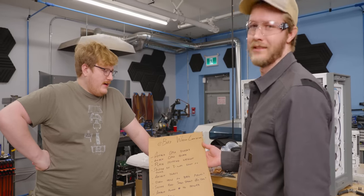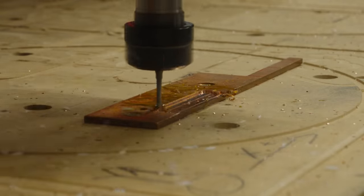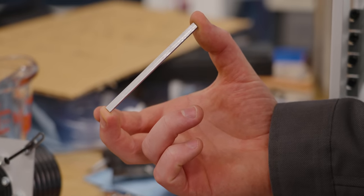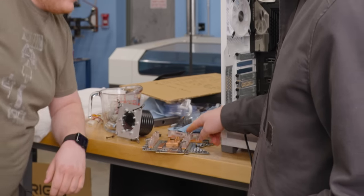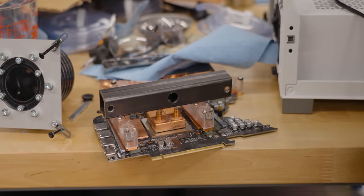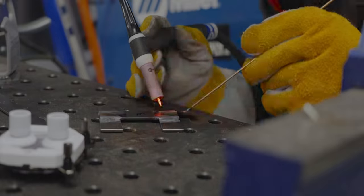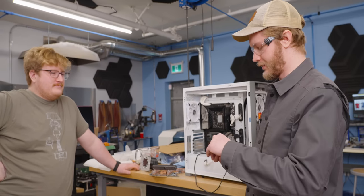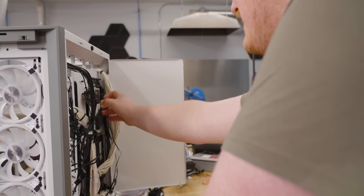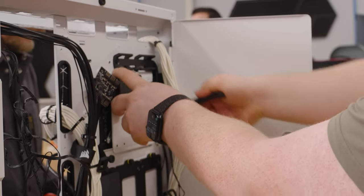We have a lot to do. I've been mostly just turning garbage into bits of water cooling. In order to attach these I machined out some copper for the memory, aluminum for the MOSFETs — those are just to space it up. I consulted multiple engineers — three of them. Do you want to know what they decided for attaching these? Zip ties and a piece of steel. For the CPU I TIG welded some steel. It looks very square. Did you try it yet? Oh yeah it works. Since it's easier, do you want to take over CPU mounting?